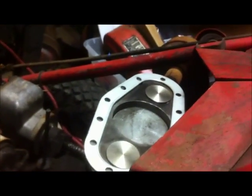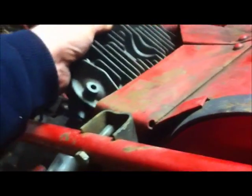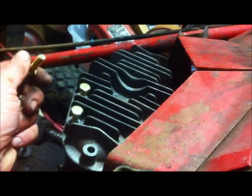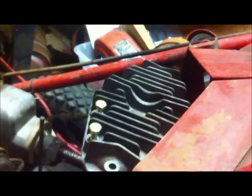The timing is all set. Now I'm going to put my head gasket on and put my head on. The head has been bead blasted — it's really pretty. I got some nice bolts here, five-sixteenth by one and three-eighths, which is the factory spec. Originally when I took this motor apart it had one and a quarter inch head bolts, which is not factory. Some guys use inch-and-a-half bolts with washers, but I figured why not be factory. I bought them for about 34 cents each — if you buy them from Gravely they're like a dollar fifty.